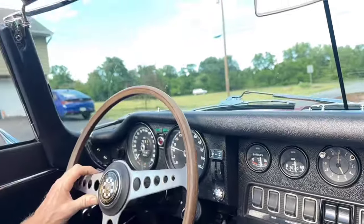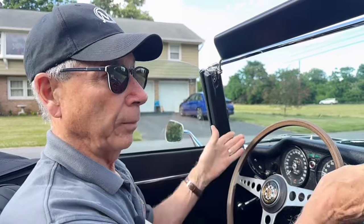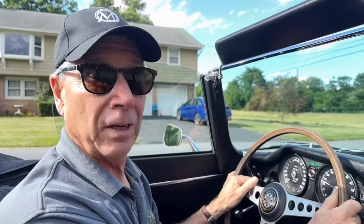There are two things on the car when I drive it that I noticed. Under braking, there's a little bit of pulsing in the steering wheel, which typically would be front rotors, and it's pulling slightly to the left upon initial braking. That may change if the car is just driven more, because I know it's been sitting for a bit, but those are two things with braking.